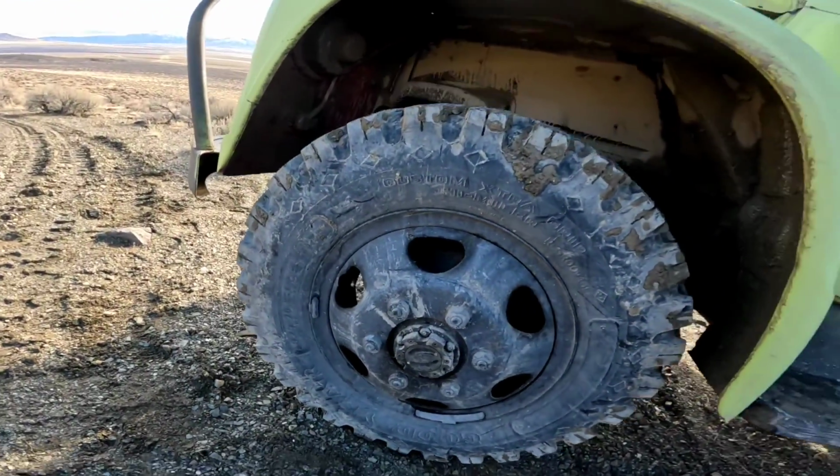So this is my new daily, and it's kind of a project truck. It's got 8 1/4 20s on it, which measure out to about 37 inches. I think that I may end up going a little bit larger, maybe 1120s, which would be 42. I bought it in Caldwell, Idaho, and drove it back to Winnemucca. So I made about 250 miles with this yesterday. The tanks do need cleaned out. I fouled out the original fuel filter for it, replaced that with an inline filter, and ended up fouling it, and had a bunch of problems on the way back, but it made it here.